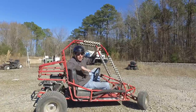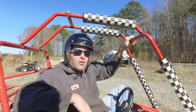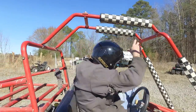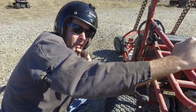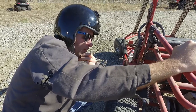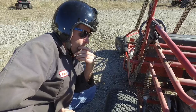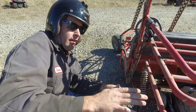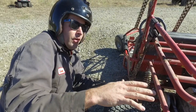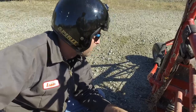It's cutting out while I'm doing the drifting — I wonder if this thing has a low oil sensor on it. Let's take a look. Yeah, this torque converter is taking a lot of time engaging. I think it needs another torque converter, a rebuilt one, or to be gone through, because it lags — it's accelerating and then just kind of hangs, and then all of a sudden you feel it start to accelerate more without changing the RPM on the engine.